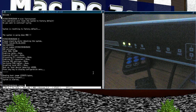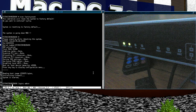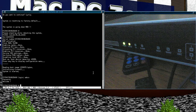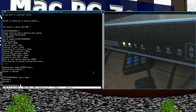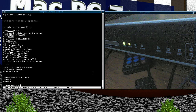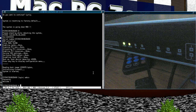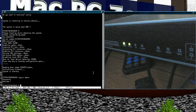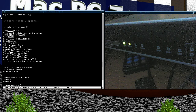After a factory reset the login is just 'admin' with a blank password, and that's it — you're in. It's as simple as that. If you ever get a FortiGate unit and don't know the login, that's how you reset it. The main thing you need is a console cable and a way to connect it to a computer. Resetting these enterprise routers is quite easy once you have a serial connection. Thanks for watching, see you.